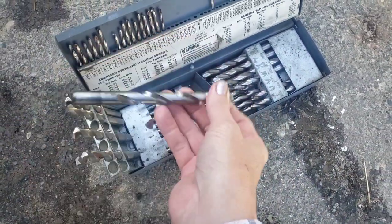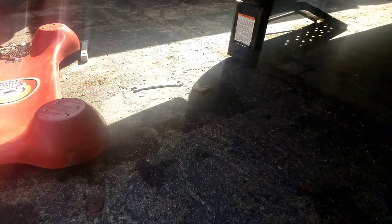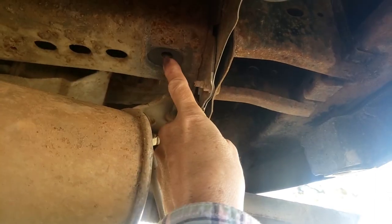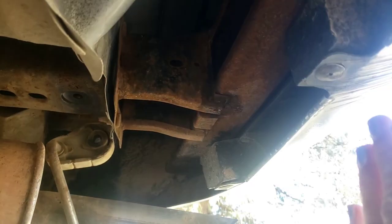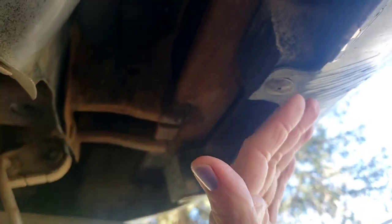With a half-inch drill, a Milwaukee, a three-quarter and a seven-eighths inch wrench, and a zip cutter for metal, we'll be able to access it. It's going to be a little harder around this muffler because the frame and mounting is right up in there just past the muffler's mounting bracket. So he took the bracket right off so we could redrill this out to a half inch for the mounting bracket for the first bolt — to have that ball right about here, otherwise it would be tucked in.